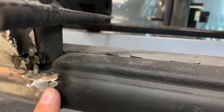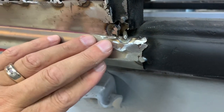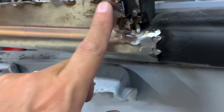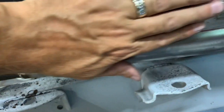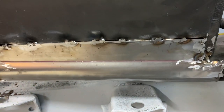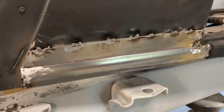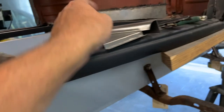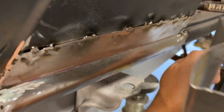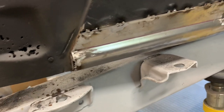I have it so it comes into here — I'll obviously weld everything better, and then this will get formed in. I don't want a seam there even though originally there was one. Then I will clean up in there, finish welding it all, and get back to the filler. This will all be good. That's just a quick one on repairing this lower cowl piece — and you can see there's no way those two shapes are the same.